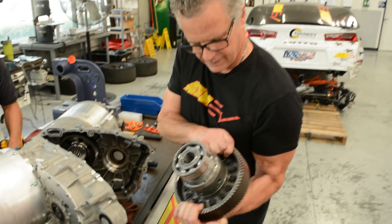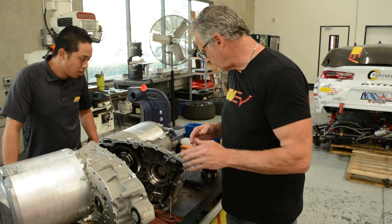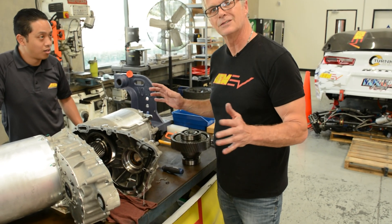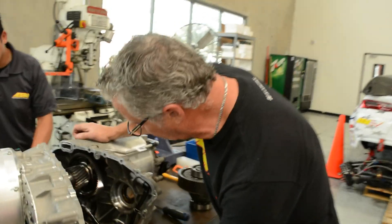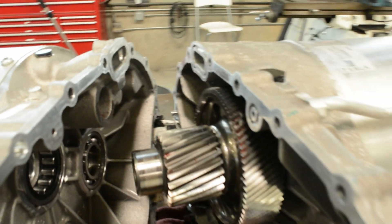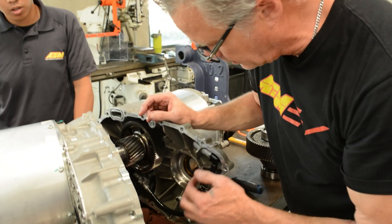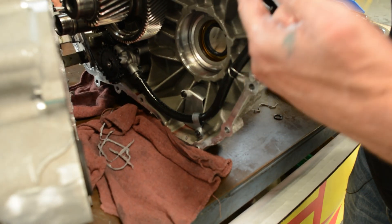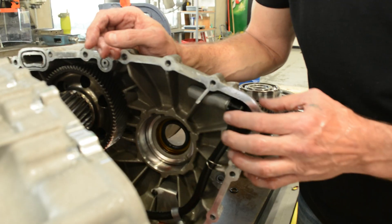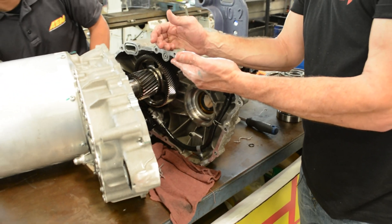Everything looks good when she comes out. I've built a lot of transmissions in my day. It's not like a traditional ring and pinion where you're worried about your ring depth. It's just so crazy that you can take the ring gear from one assembly and put it into another and it works. This is kind of cool too — because of the way the Camaro was configured and the space restraints, they have it mounted upside down. They literally took the front and rotated back, so forward is still forward and backward is still backward. But what that also meant is that the sump that usually sits here needed to be here, which explains this bizarre hose, these clamps, these extra wires, and some pieces that have been hand-machined to accommodate this hose extension to allow the oil pickup to pick up from what, when it's in the Camaro, is actually the sump.